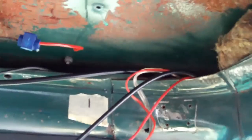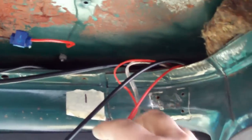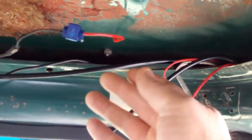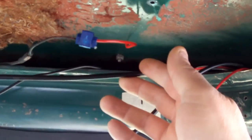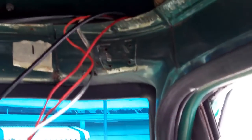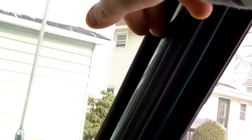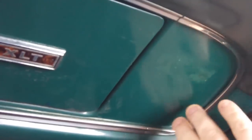You've got to make sure you run everything you want. I have wires run on this side — I've got my antenna wire for the radio, I have my CB antenna wire, and I have dual antennas for the CB. So I'm running up this post here, you go down here through here and it comes out right underneath the dash. There's an opening on both sides.